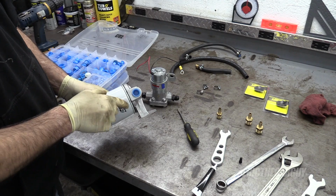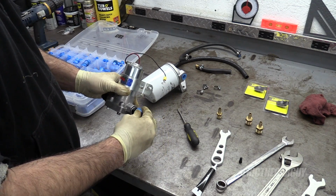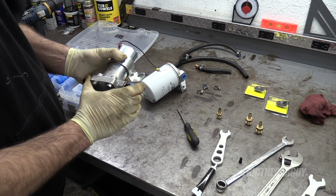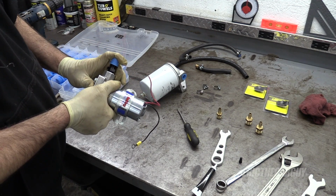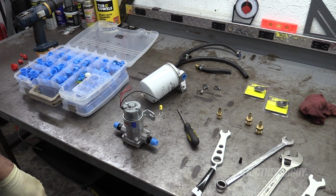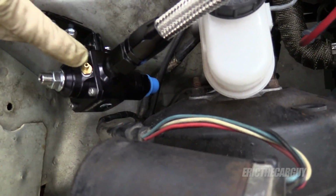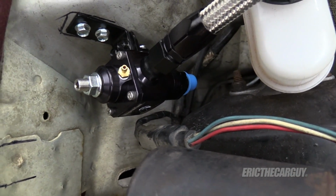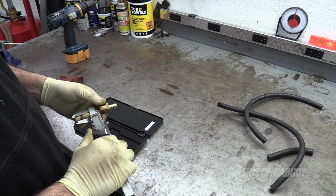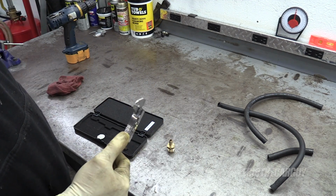There. Don't leak bad. And because I'm awesome, well, actually, Shane Craig is awesome because he sent me these things here. He's a diesel tech up in Alaska, and they're very conscious about environmental problems and such. Look at that. In fact, I'm going to go throw one of those on the fuel pressure regulator on the car real quick. Yeah, you remember that -8 that was coming in there that was just open? Not anymore, it's not. Otherwise, let's see if I got a teeny tiny one for the vacuum port. Just to be funny. Didn't think I had one, did you? Take that. All right, what size is this? 5/8. So it's a 5/8 NPT to -8 is what I'm gonna need for that.